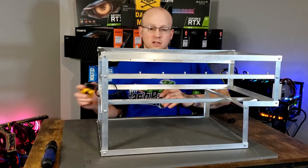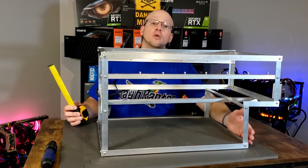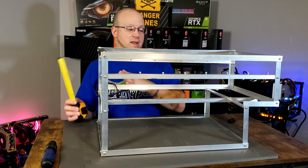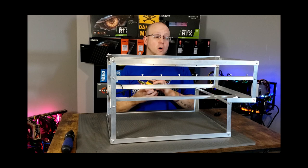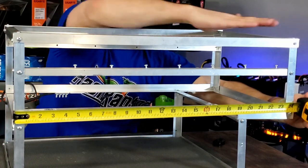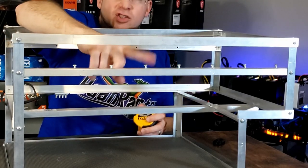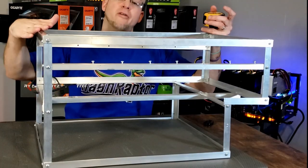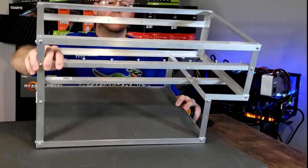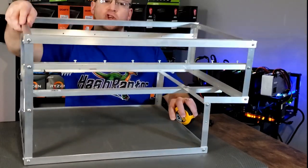There's no beating the solidity of this frame — this thing is a beast. Let's look at the specs. If you were building an eight-card rig, you would just make it a big box rather than this complicated hangover part I had to do. For a six-card rig, you would do 20 inches across; for an eight-card rig, 28 inches across. This frame was made out of all angled aluminum, and the cross member is actually more like a U-channel — it's called trim channel. The rest of the frame is L-shaped.